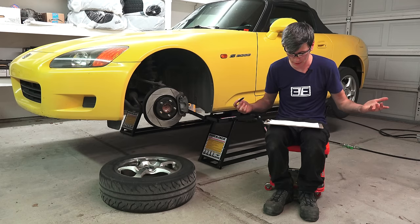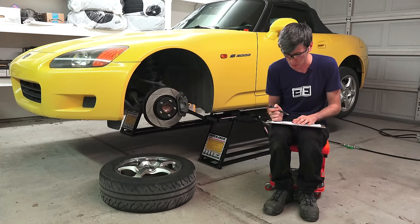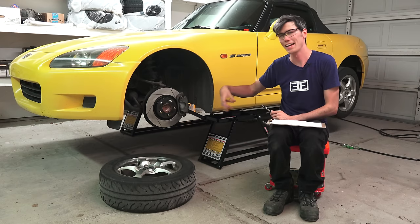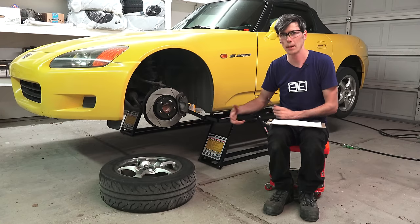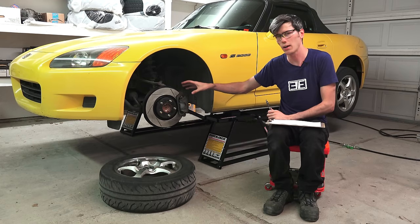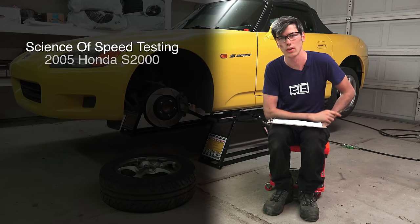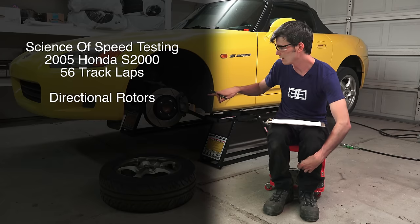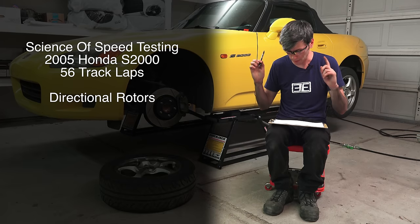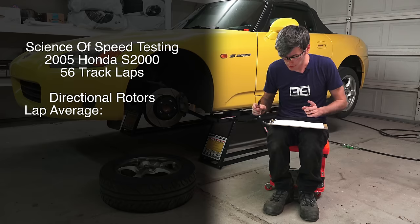What's interesting is that all my testing was done at very low temperatures — as high as 190°C, but for brakes that's not very hot. On a track you'll see significantly higher temperatures. The best way to test this properly is a track comparison where the brakes get really hot, because cooling efficiency at high temperatures matters more than mass — if mass can't shed heat it just keeps getting hotter. Science of Speed actually tested these rotors on a track over 56 different laps with an infrared scanner reading brake rotor temperature throughout each lap.